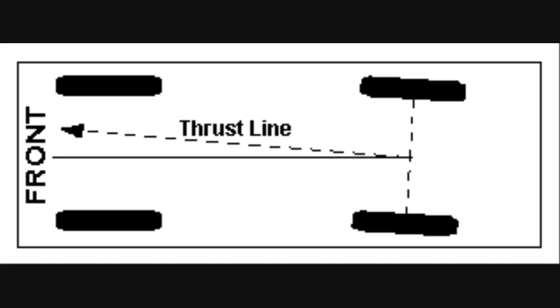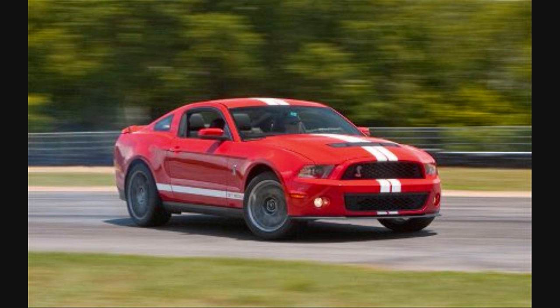On this particular car — a 1979 Chevrolet Malibu station wagon — the rear suspension is not adjustable. The only way to compensate for that is to have the front end aligned to match. That wasn't acceptable to me. This car had never been in an accident; I knew the original owner. It had just come from the factory with the rear axle crooked. The driver's side left rear tire was actually one half of an inch forward more than the tire on the other side.